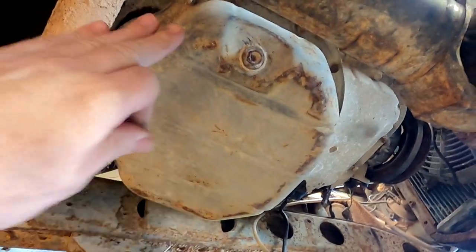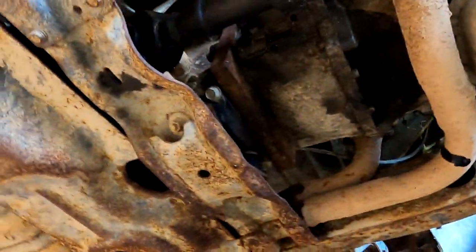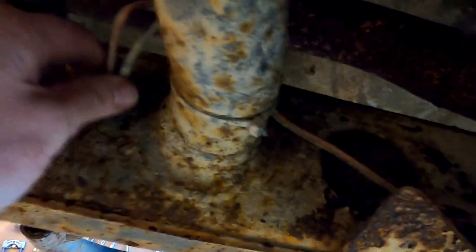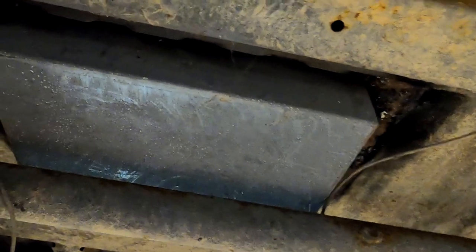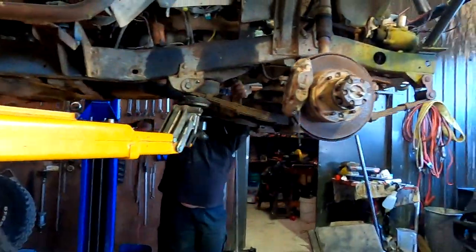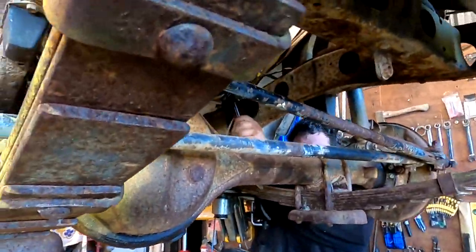The oil pressure sensor fits excellently. The truck is still going to come up really nice even though it looks a bit rough right now. There are some concerns about the fuel pump assembly — it really should go in the tank with a proper filter before it. Also, the battery tray coming through the floor is a bit silly — it could have been placed right under the back of the floor or on the side of the wheel tub.